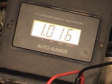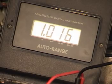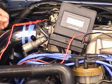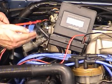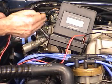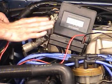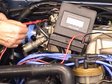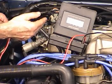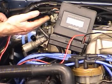1.016 — that's perfect for a closed throttle. Now what I want to do is to exercise the throttle and make sure that the voltage changes with the throttle blade angle change. You may not be able to see the display very well, but I'm going to move the throttle from the idle position all the way to full throttle. I should see a steady climb in the voltage. If I suddenly see 5 volts or suddenly see 0 volts, then there's an open circuit in that throttle position sensor, and most likely it would have to be replaced.